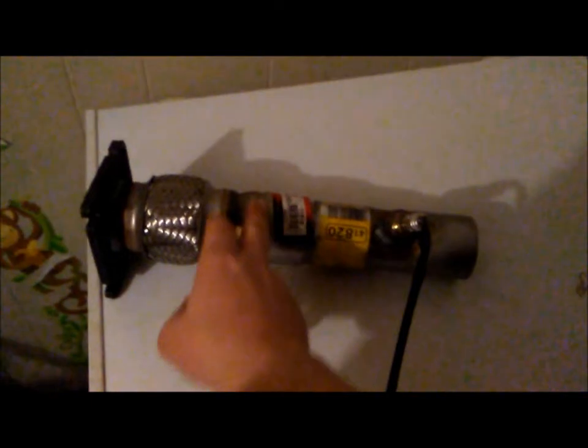That's all there is to it. This setup cost me $72.96 so far. You'll also need to buy clamps — one on each side of the assembly, and possibly one more if you need to add a short exhaust pipe section to connect to the rest of your car's exhaust. So plan on two to four clamps total. You might also need a small exhaust pipe section to bridge the gap.